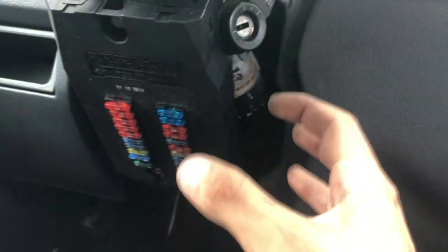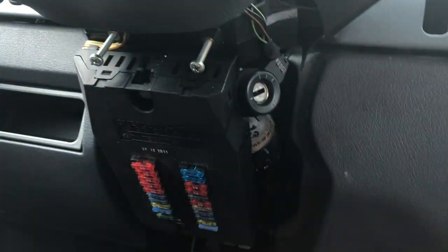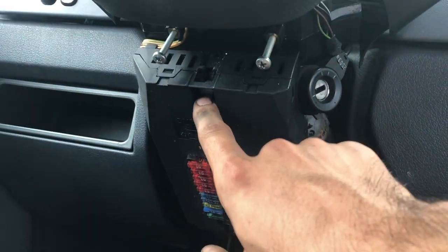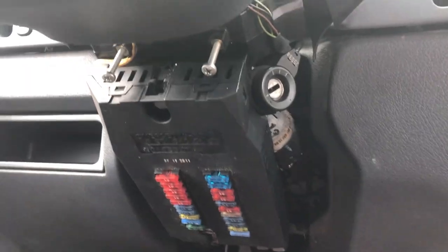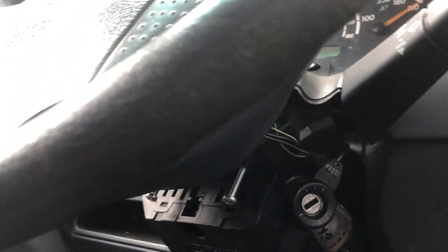There is normally a plastic shroud that goes around here that you will have to take out — that's pretty easy to get at. There are two Phillips screws at the top and a 10 millimeter nut at the bottom. Then you're going to need to pull the 10 millimeter captive bolt up top and the 10 millimeter nut on the bottom to pull the fuse panel down. Once you've done that, get in on each side of the steering wheel through the little access hole.